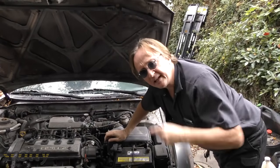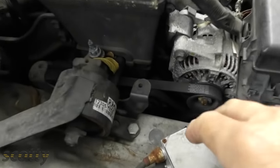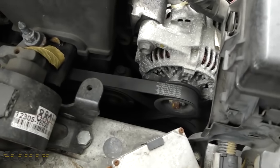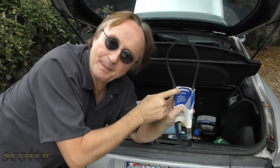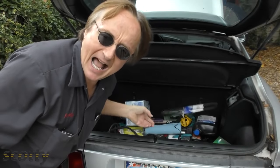Well, if you don't find any blown fuses, you've got the hood open anyway — check the fan belts to see if any of them came off. For example, if your alternator belt came off, the alternator will stop charging the battery, you'll run out of electricity, and the car will stop running. Be prepared — have a spare fan belt for the alternator in your trunk so if it ever goes bad, you've got one to put on.